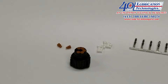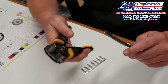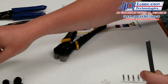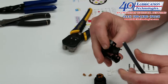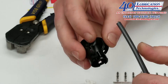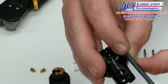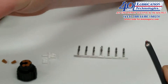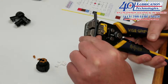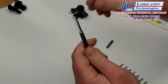We're going to take our two wire power cable and first we need to strip the outside sheathing. Before we strip, we need to note that we don't want excess wire exposed outside the connector — we only want to strip off what we need to go inside the connector. So about this much will do, and we're going to strip the outside sheathing.